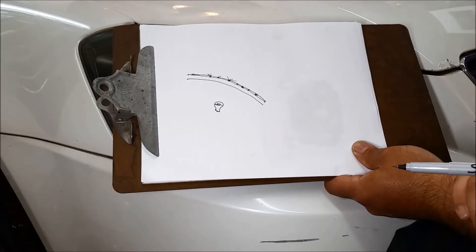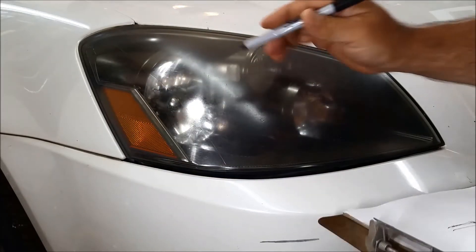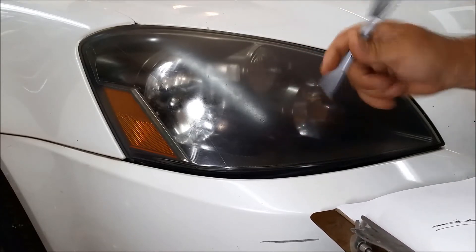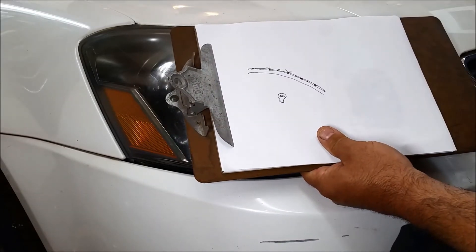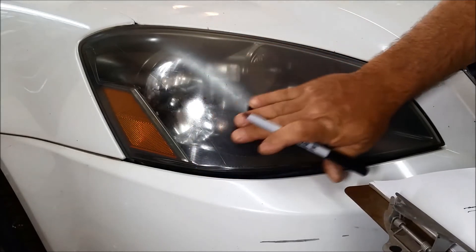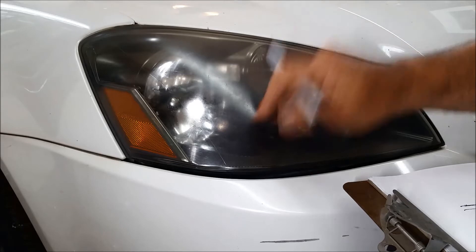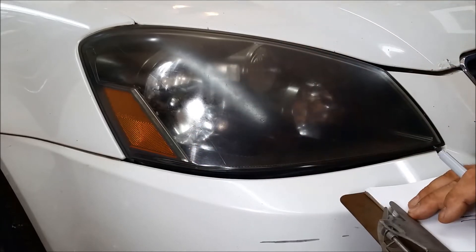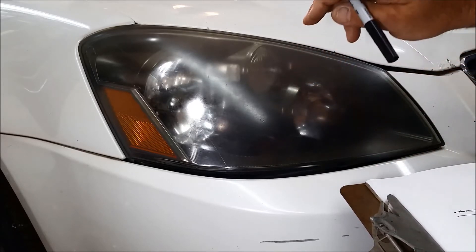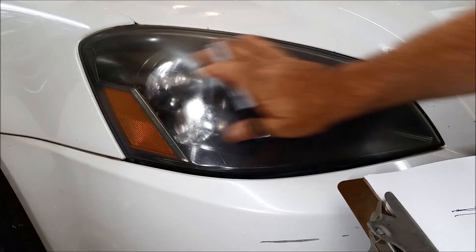That's really it in a nutshell — two things. And that's why a lot of methods work: WD-40, toothpaste — what you're doing is getting some of the dirt out and filling that void with something. It could be wax, toothpaste, an oil-based product. What that does is re-flatten the lens or fill the void so you can see straight through it and stop the light from being deflected. So we're going to do three things: clean it to get the dirt out, flatten the surface back out, then put something protective over the top.